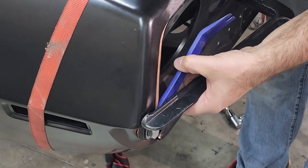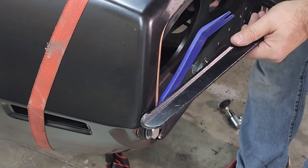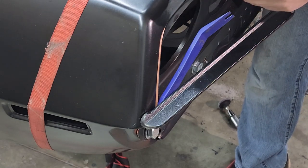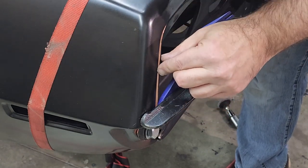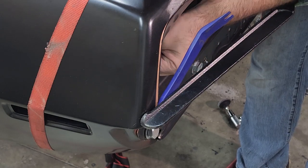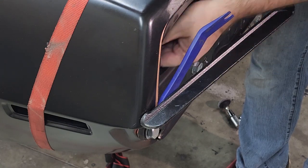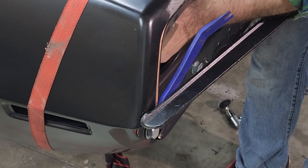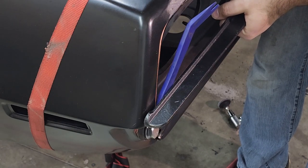Shove it in. And if you tighten down on it, you can see how it's starting to move in. And then you could use the C-clamp for a little leverage. What's nice about these, the small ones, is the duckbill one covers that much area. If you want to do little increments, use a little one. So get my big hand in there. You see the quarter panel moving in, the tail panel moving in. There we go. Push on this a little bit to get where you like it.